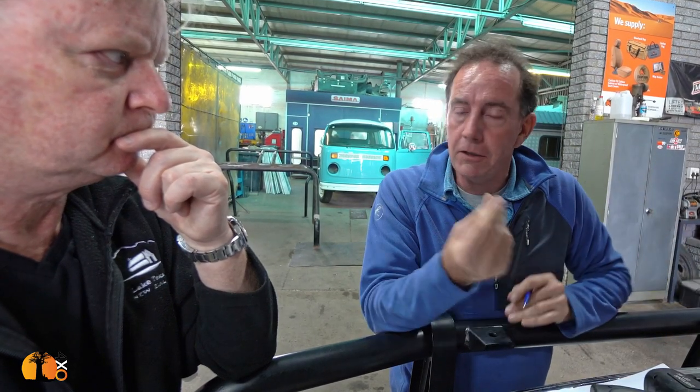The fact that you've had a good drive down here has already built a lot of confidence for me. The oil was a bit low when you picked it up, so I always run the engine warm, check the oil first, see what the level is and the condition of the oil. It was very black and didn't look like it had been changed in a while, though these engines do go black very quickly. On expedition, I look at the dipstick and look at the colour and dirtiness of the oil, looking for contaminants like bad fuel — if you pick up really bad unrefined fuel, after 1,000 kilometres the dipstick can already go very black and the oil starts to thicken, showing it's becoming contaminated with unburnt particles.